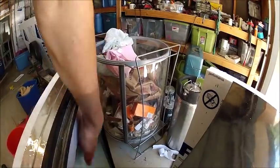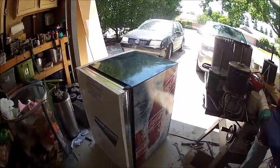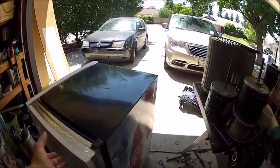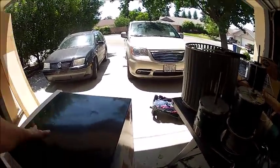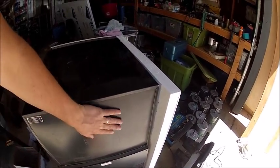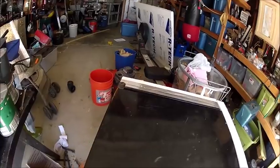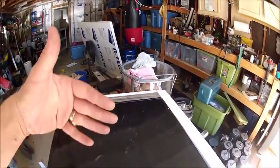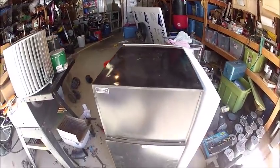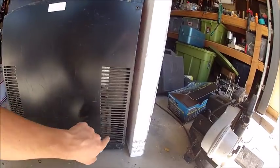This is one of those fridges from the top of a convenience store counter, so it had glass on it. The glass isn't very efficient but it let people see what was inside without opening it. With these fridges you've got an insulated door and insulated side, top, and bottom panels. You can actually feel the temperature difference — they're cool to the touch — and that front door panel was terrible, really cold, so it was obviously bleeding a lot of cold. This part down here is warm because it's got the compressor in it.